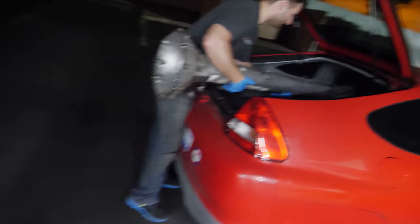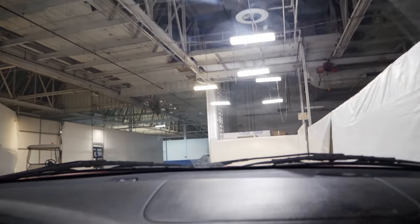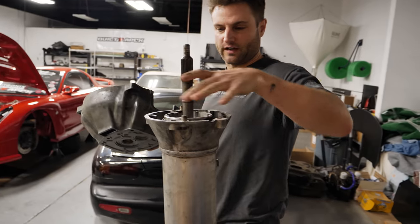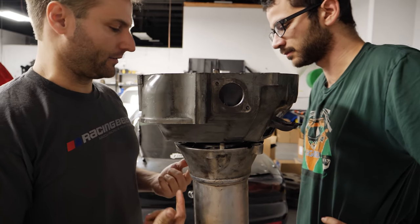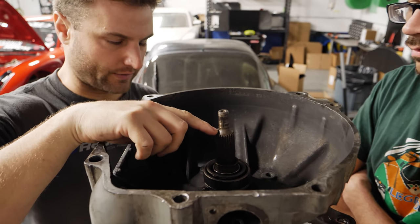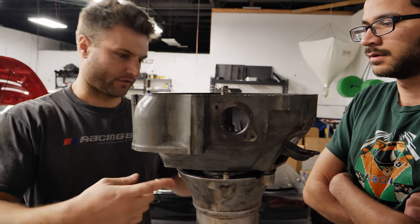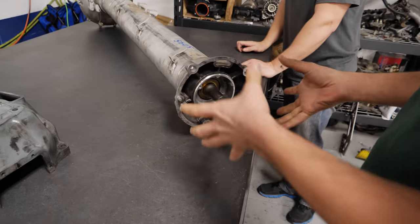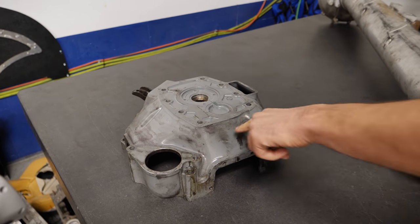Simple rundown: this is an eight-bolt and this one's five-bolt — we can do six bolts without a problem on the bell housing, because these two get close to touching on the bottom. I'd rather prioritize five on this side and six on the other. I'd double-check by seeing how far this goes into the flywheel, then we'll trim it down to get the bell housing to the correct height, which determines the final depth of the adapter plate. Should we do some 3D scanning? Yeah, that'd be fun. I'll scan all of this and use it as a reference point — let me get my laptop.